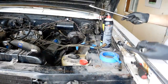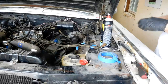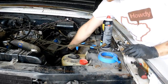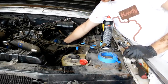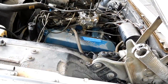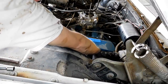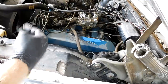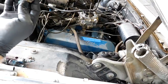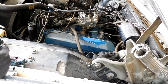It's strange that it would run when I didn't put gas in the carburetor, and then once I did put gas in the carburetor it didn't want to run at all. The weird part is it felt like it was locking up at a certain spot — makes me think the carburetor flooded the engine with gas. I'm going to take these spark plugs out and see what it looks like. Cylinders are numbered — pulling number seven, smells straight up like gas, that's nasty. Number five about the same. Number three not as bad. Number one is black and sooty but not wet.